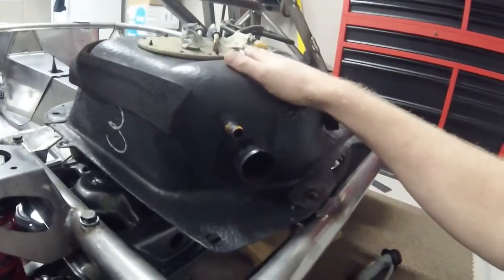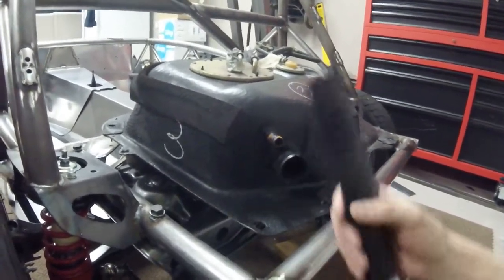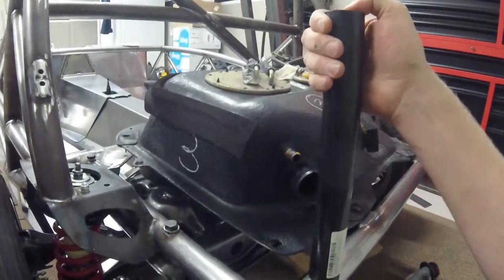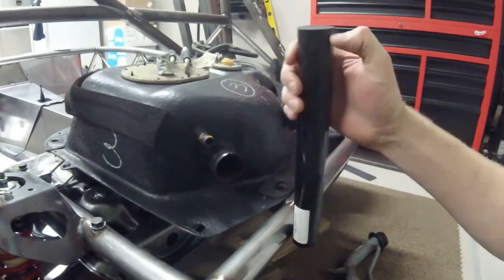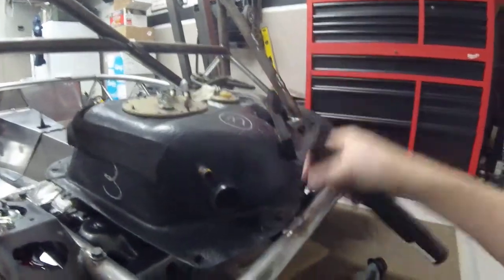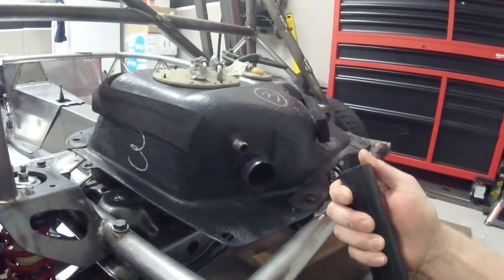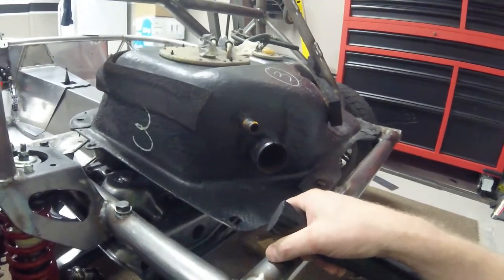I've purchased some polyurethane — basically a plastic nylon rod — one and a half inches thick. It's very stiff, not bendable, not rubber, but it does have a slight bit of cushion compared to metal. This gives a very wide surface area to make mounts for the tank. I'm going to be cutting this down using shoulder bolts and drilling the middle out for the shoulder bolt to space the tank up off the frame. I'll get these mounts made and show you what they look like with the measurements and details.